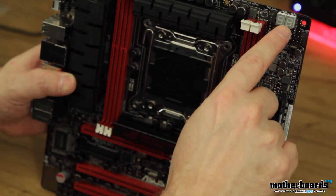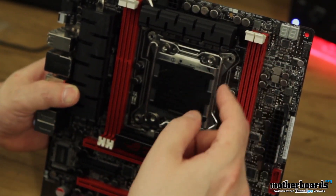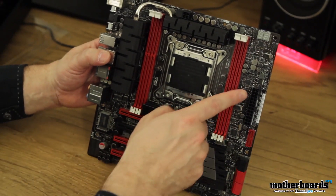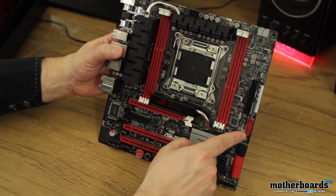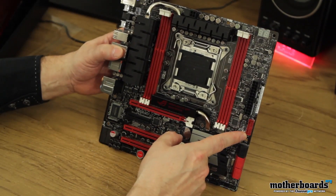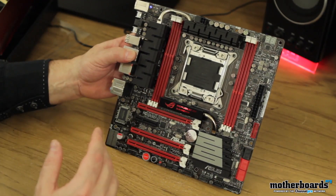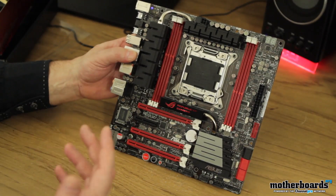Right here is the LED that will tell you if you have any errors on your motherboard — it's going to blink out a couple of numbers, and inside the motherboard guide it'll tell you what's actually wrong. Hopefully you never see anything but 100% solid. Right over here we have the 24-pin power connector. On the side, the USB 3.0 connector is usually blue, but on this particular motherboard it's red to match the color scheme. The LGA 2011 socket supports all the latest Intel i7 Extreme CPUs, including the 3960X, which we use in a lot of our other testing.